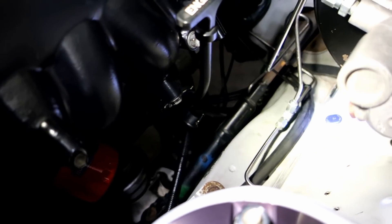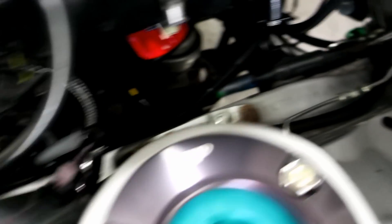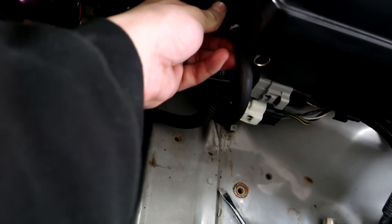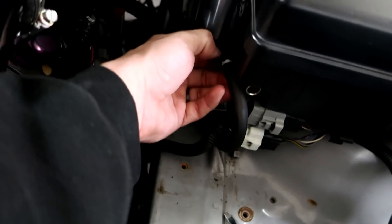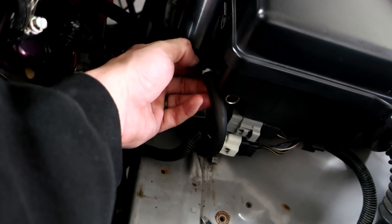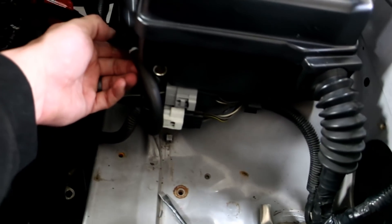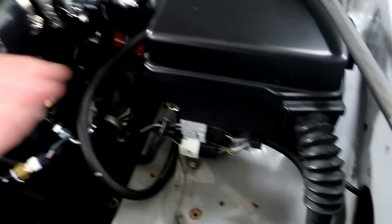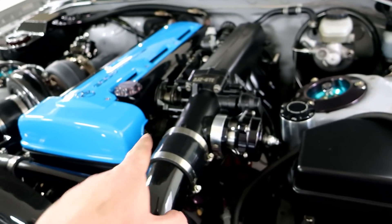You can see the black wire right there — I used a cushion clamp right there. I don't love that it's on top of the frame rail, but it would have to come through this hole or through the frame rail otherwise, and I don't want it rubbing. I'd rather be safe. It runs up there, I had to use one zip tie and the cushion clamp. Now I'm about to cut the line itself — you can see I've got a Sharpie there. I went ahead and removed the factory power here, and this is where it should go — that gives me a little bit of play. I don't want it too tight, but I don't want it laying on there either. Out here I won't be using a red label even though it's a power wire — I'll just put a black covering on it because I think it'll look better.